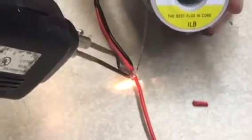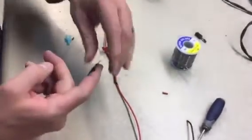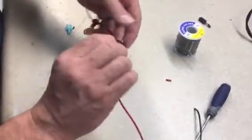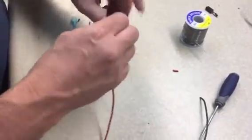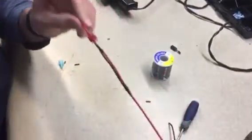Then take your solder and watch it melt - drop that on there, boom. That thing is soldered - it's a perfect weld. Again, tape - just a small piece. Start it right there on the corner, twist and pull. And that is professional, and that's a rock-solid contact. You're not going to have any electrical issues whatsoever. So there's your electrical 101.